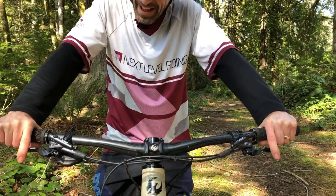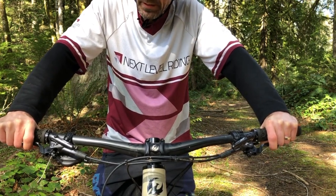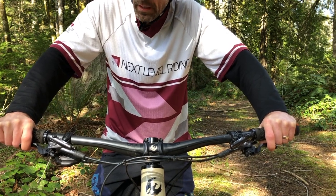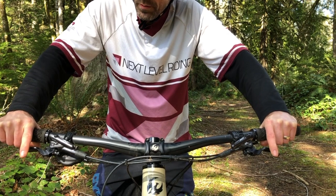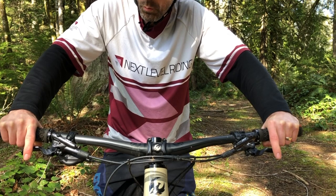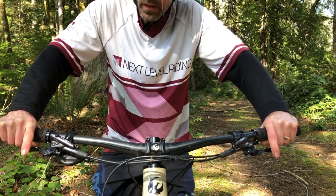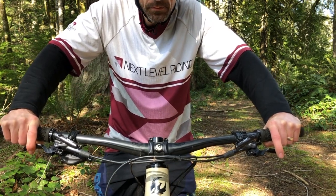As you can see from the position of my hands here, I have just one finger on the brakes. A lot of adult mountain bikes are designed to be used with just one finger. The reason we use one finger is twofold: hydraulic disc brakes these days are very powerful and don't need much force to pull on them, so you can easily pull a modern brake lever with one finger.